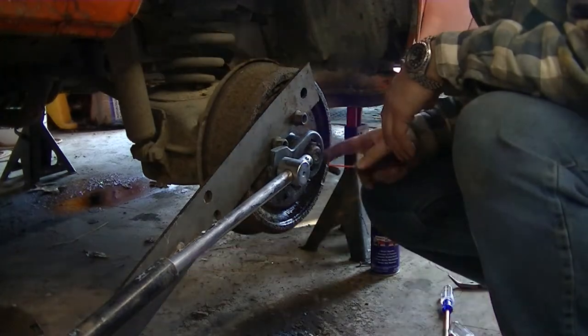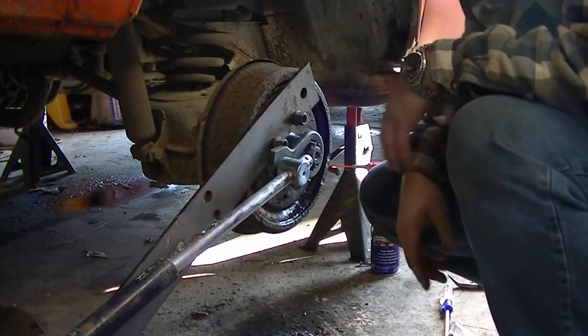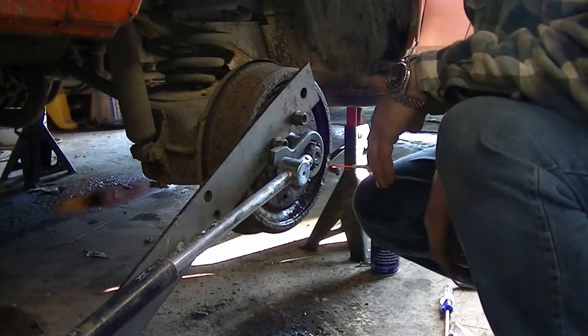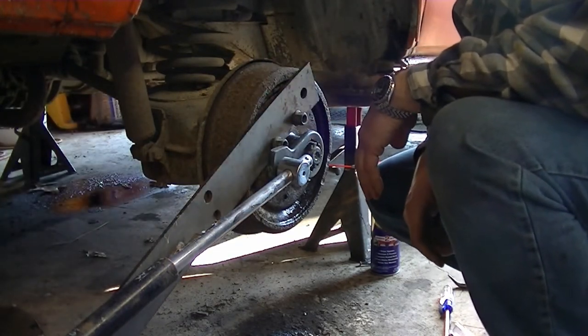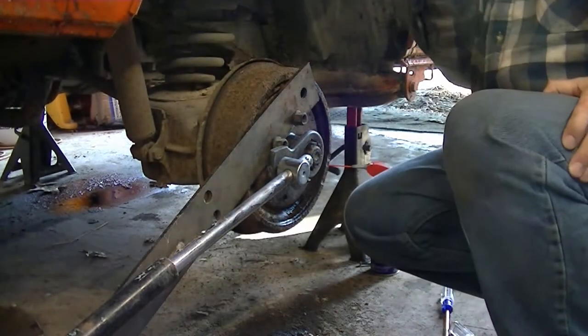Right here in the center around the hub is where it's kind of frozen. It's like the two pieces are stuck. We've tried WD-40, a lot of different things. We didn't bore you with all that part. So we're going to some drastic measures. We may actually have to replace this drum because it is pretty nasty. If we take it to the shop, we'll see if we still have enough clearance to turn them. So let's go.